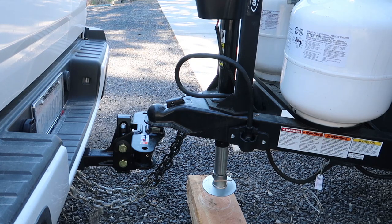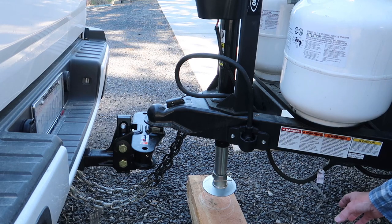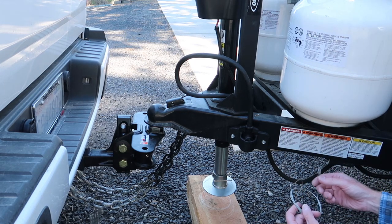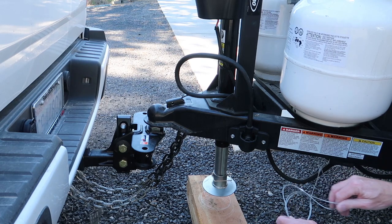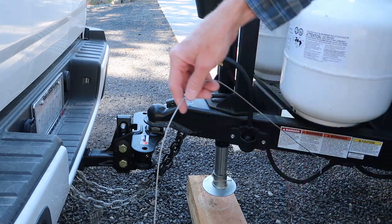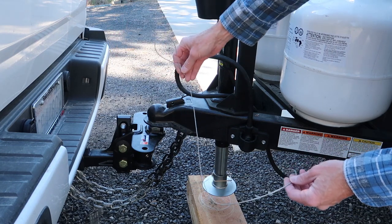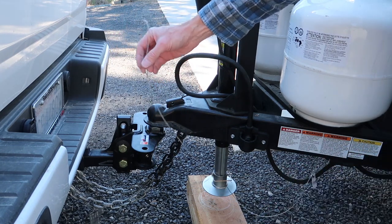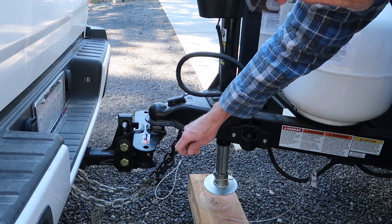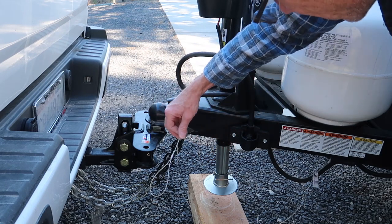Let's talk about a quick and easy upgrade that you need to do to any trailer that has brakes on it. Over here we have the breakaway switch, and as you can see it's got a little cable on it — a little tiny diameter vinyl coated steel braided cable. Look how long that is. You end up having to loop this around things to keep it from dragging the ground. The other problem is it can easily get pinched in your torsion bars for your weight distribution hitch system.